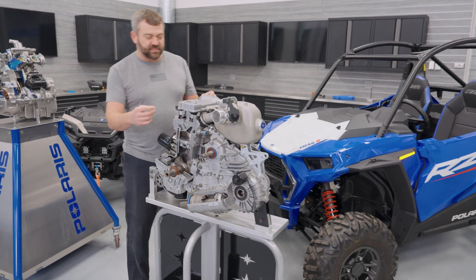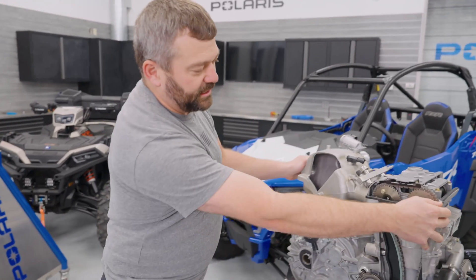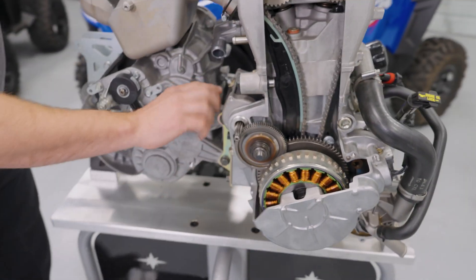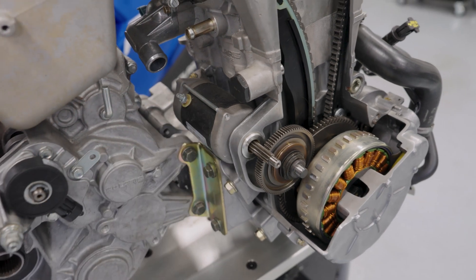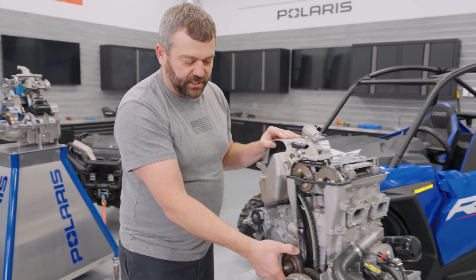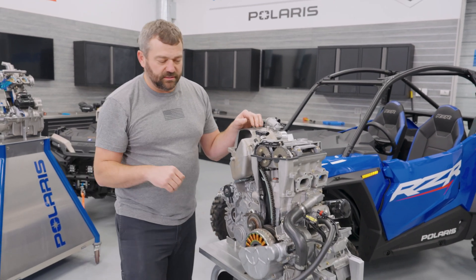Big differences over the ATV — let me spin this around — but this is actually a twin-cam motor, so you can see there are two camshafts on top: one for intake, one for exhaust. Still four valves per cylinder. You'll notice the water pump isn't sitting outside the stator cover here, so this is more of a conventional architecture. And if you look at the starter motor, there's no solenoid on top — it's a sealed starter motor assembly where one cable hooks up to an offline start solenoid. This one also has a sprag clutch, a one-way clutch in the crank train for the starter, which is a little different than the pull-start style on the ATV engine.